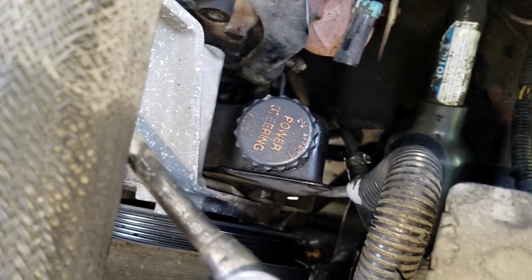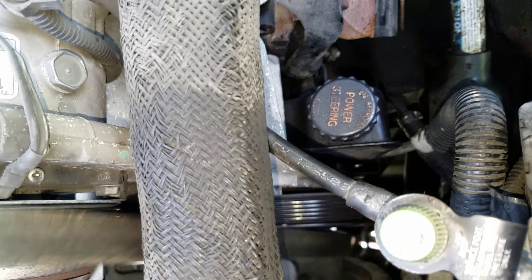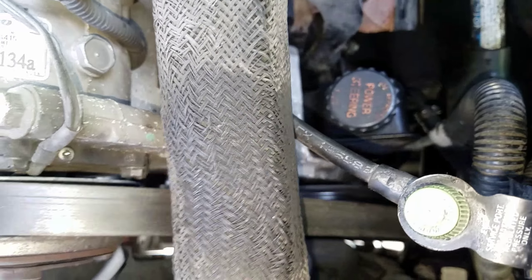There's one in that corner there, and a bolt right there that's loosened up. You can see how this bracket has slipped away from it — it's got a slot in it. Easy, just loosen it up. You have to take the belt off, so I use a 3/8 drive long ratchet wrench to get that belt off. That's all there is to it — pretty easy.